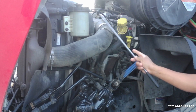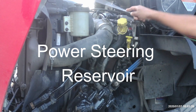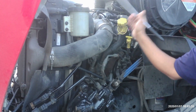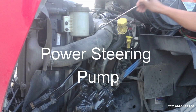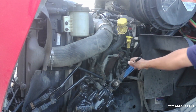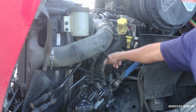Next, we have the power steering reservoir. Power steering reservoir is not leaking or damaged. It has a cap and a dipstick. If needed, I'll fill it to the proper level and recap. After that, we got the power steering pump, which I cannot see, but I can follow the power steering line to it. It's securely bolted to the engine, not broken or damaged, not leaking. It's also gear driven and it helps with smooth steering.